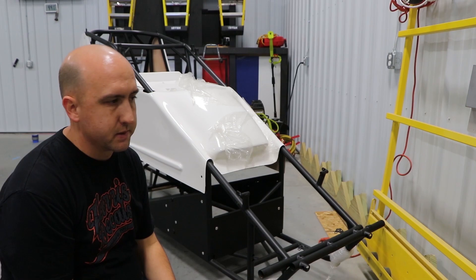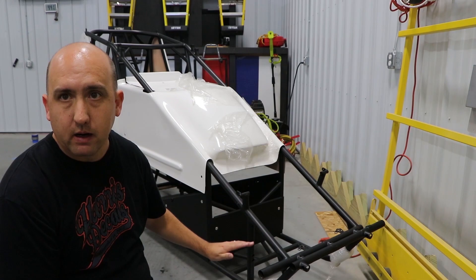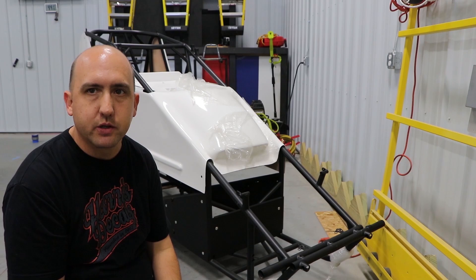What I'm going to do now is take knifeless tape and put it in the seam. What's nice is we have bright lights in here, so I can see the gray areas. You want to look at the gray area and get that knifeless tape where you're going to overlap right in that area, because when it's gray it's typically darker so you can't see it. It looks like it actually transitions the way it should.